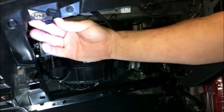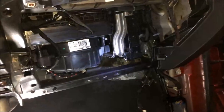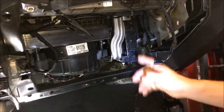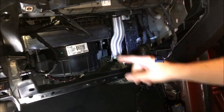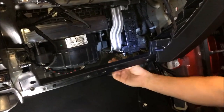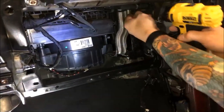Get her up out of our way. If you really want this out of your way — I'm just going to leave it right there — this will unplug and pull through here instead of fighting that. You can unplug it and get it out of your way, but I think we're okay there. So we're replacing the radio and the HMI. Both sit right here. The HMI is hidden behind the brace here, so we've got two 10 millimeters here that need to be dropped down and then two sevens.